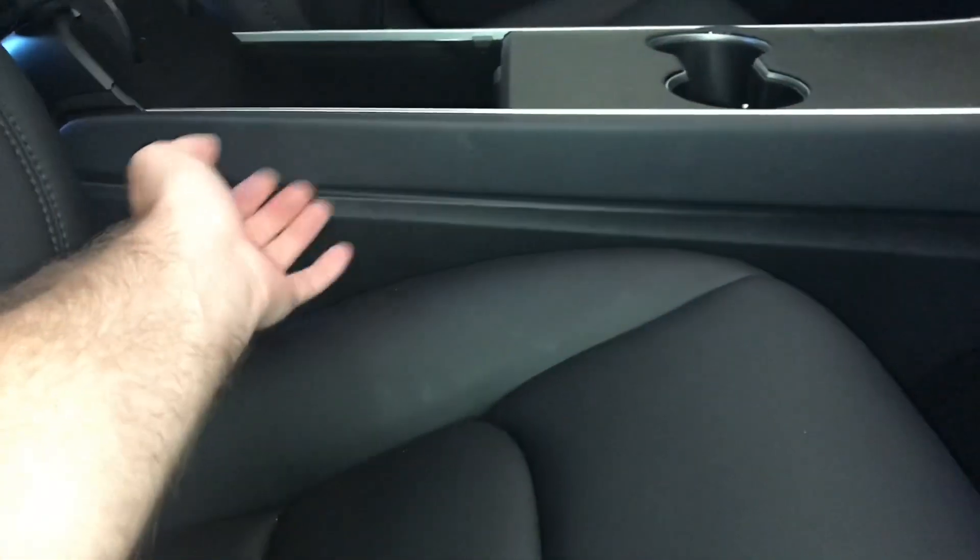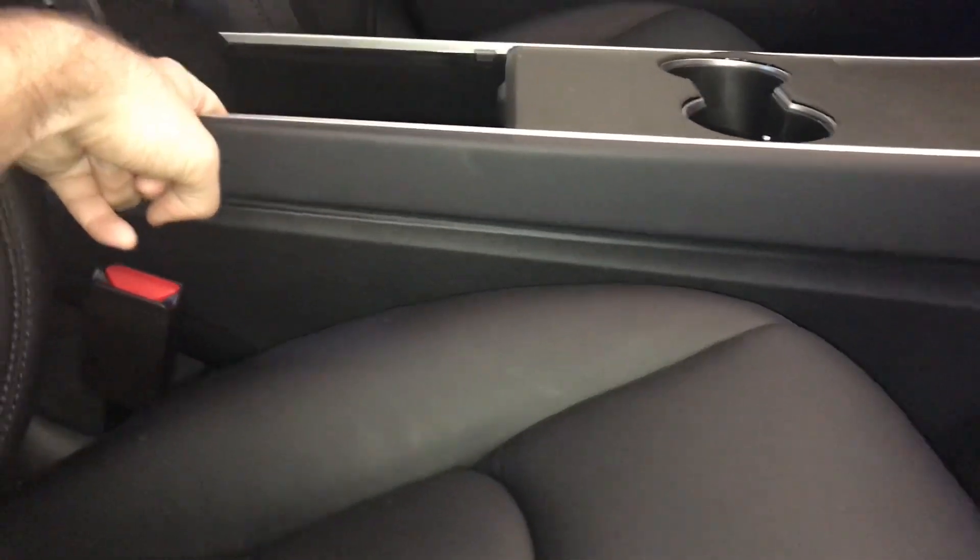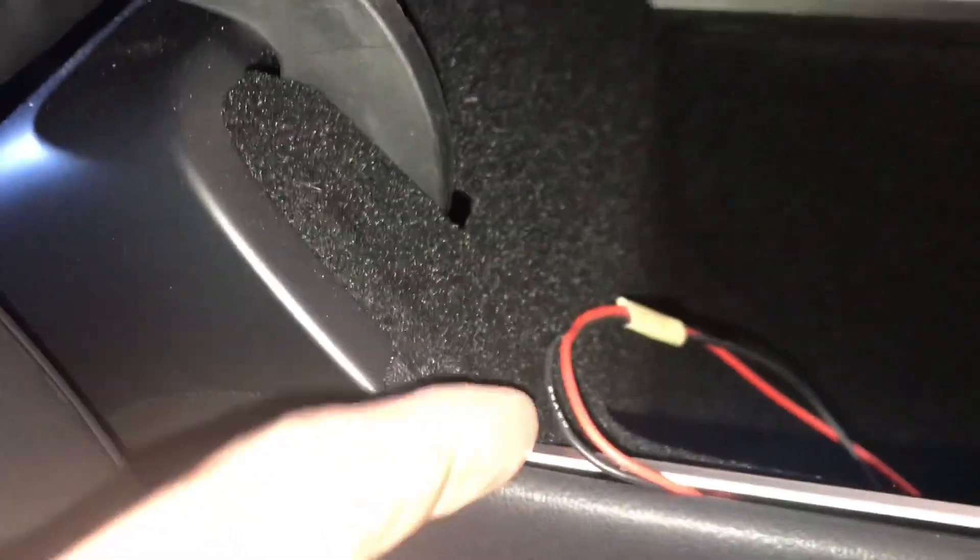The cables fall back behind the felt siding, and you bring it all the way up to the normal molding piece for your center console. You can route them in by pushing with your finger — they'll stay in the further you go back. If you move your passenger seat all the way back, you can detach the backside and route your cable underneath and into the console where the cigarette lighter port is. That's where you put your USB adapter. The cable now comes through here, and you can route it a little further back so it's less visible.